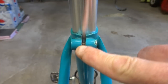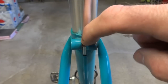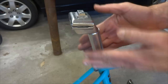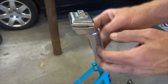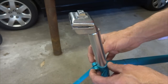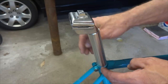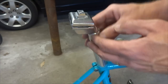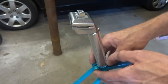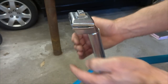The gap in the back here looks healthier and is not as tightly pinched as it had been with the other seat post. Now keep in mind I expanded this to fit the proper intended size of seat post into this frame. Do not try to expand this to fit a larger-than-intended seat post — you'll likely damage the frame and the seat post won't go all the way down into the seat tube as it should. Only try to do this in cases like this where the tube had been compressed down.